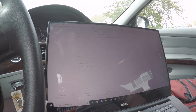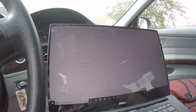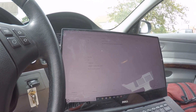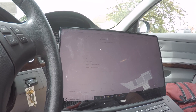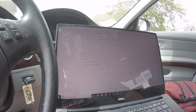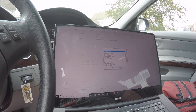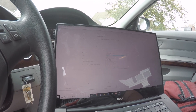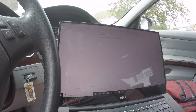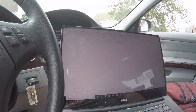After you do this you're going to see your radio and iDrive screen reboot once, but it won't be working yet because we haven't coded the media control unit yet. So go to Change ECU, go to the media unit, hit OK, then run SG_CODIEREN again and execute the job. Do that and your Bluetooth will be enabled at this point.